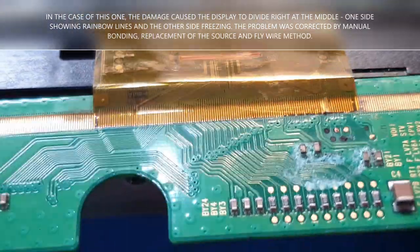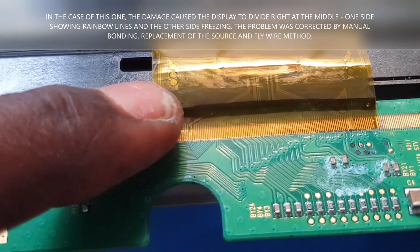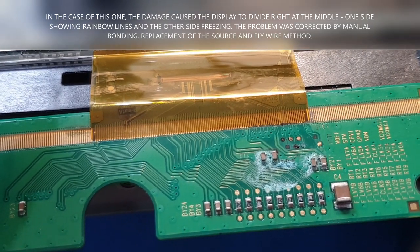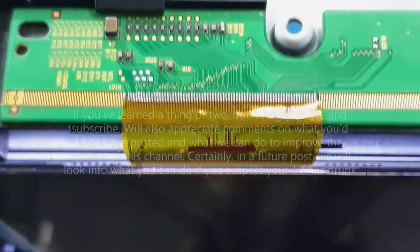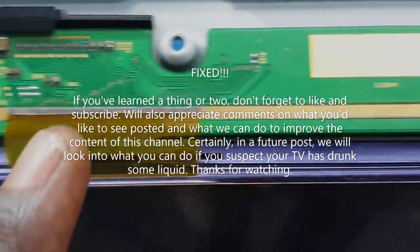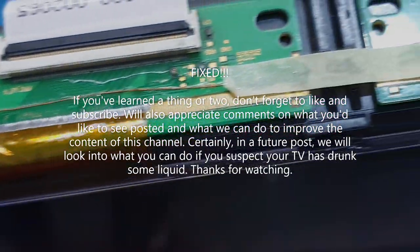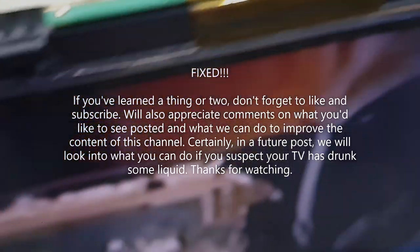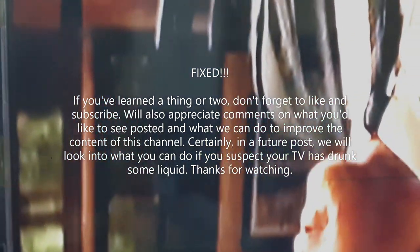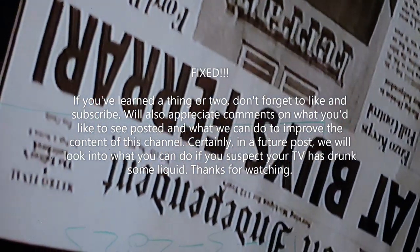In the next video, you can see the corrected, repaired screen. You can see those dark spots on the COF — that's a result of the water. On the right side too, you see dark spots from disconnected lines. Now we have the fixed screen placed back in. It's manual bonding and soldering — we've been doing manual bonding and soldering since 2010, and in fact pioneered manual bonding here in West Africa.